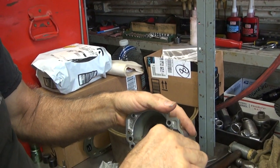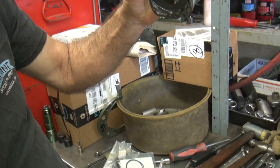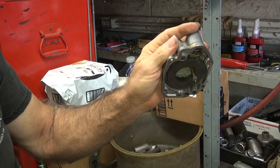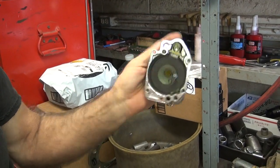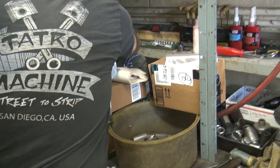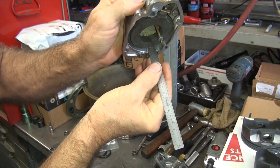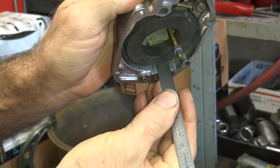Pushing it down loads the float. I didn't read the S&S rebuild kit instructions, so I'm not exactly sure the 100% number it's supposed to be. But see how that one there is a little bit closer to 5/16. You could be 3/8 too, but a quarter inch is going to probably leak. We're right at a quarter right now.